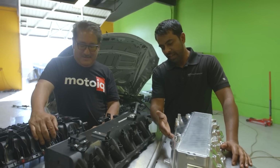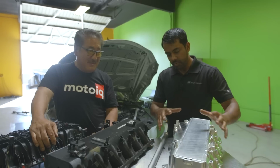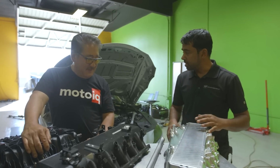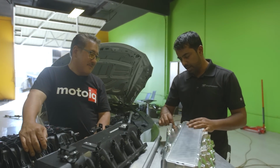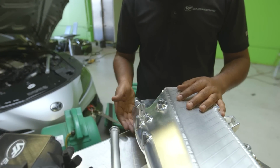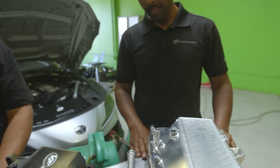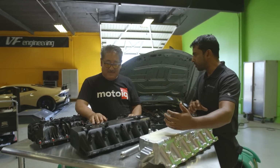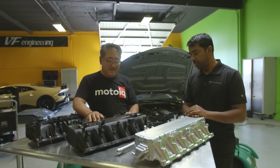Yeah, most would think that that is just an aesthetic feature, but there's always something going on somewhere, and not everything is as obvious as it may seem. Some of these features over here and these angles here all have a practical purpose, and are not just a physical feature. It's all to help the air to make the corner. Using as much of the core as possible is going to get us as much efficiency as possible.